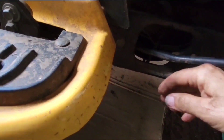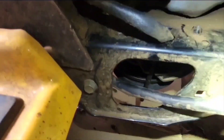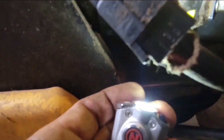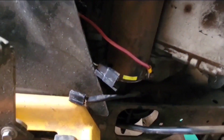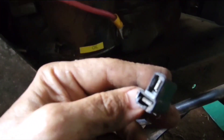Here's the wire — there's a wire right here that goes down in and hooks into the PTO. I'm going to disconnect it right here at this connection and check to see if there's a ground — if either side is grounded. To get this apart, I'll just put a screwdriver down in the bottom and lift that up so it should come apart. I'm just going to test these wires to ground for continuity. There's no continuity to ground with either one of these spades, so that's probably good news.